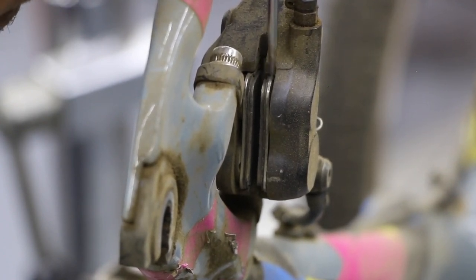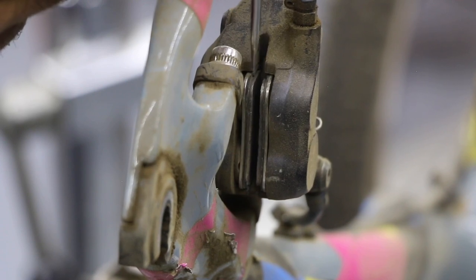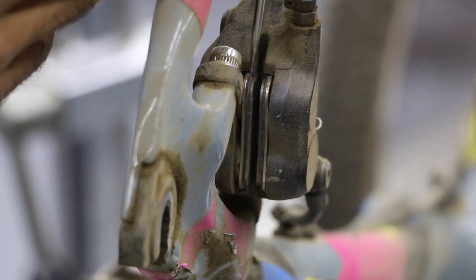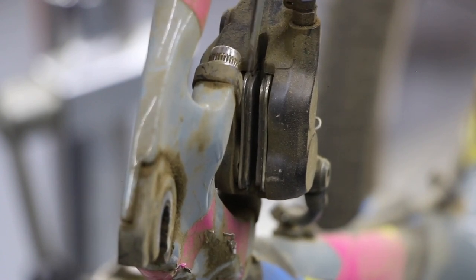So this one here is giving us a silver backing. All this piece right here, that's our metal. This can also be black and it can also be very dirty and everything blends into the same color. This right here, that's my thickness of material. So I'm running pretty close to a new pad. I probably have about 3/4 of life left or so. If we can determine that when the wheel's on, then that's all you need to do. But like I said, you could always take your pads out at the same time, but good pad thickness there.